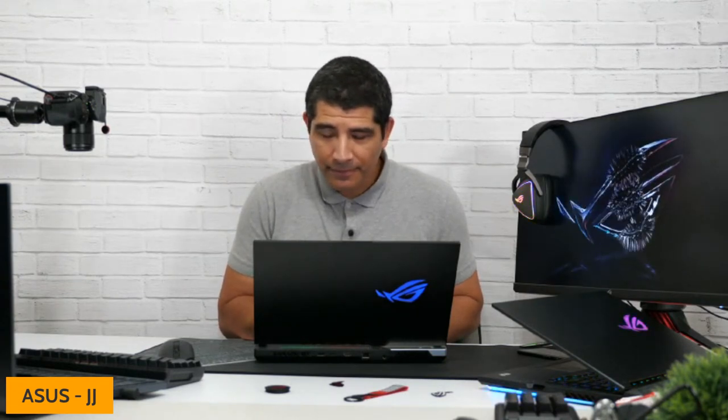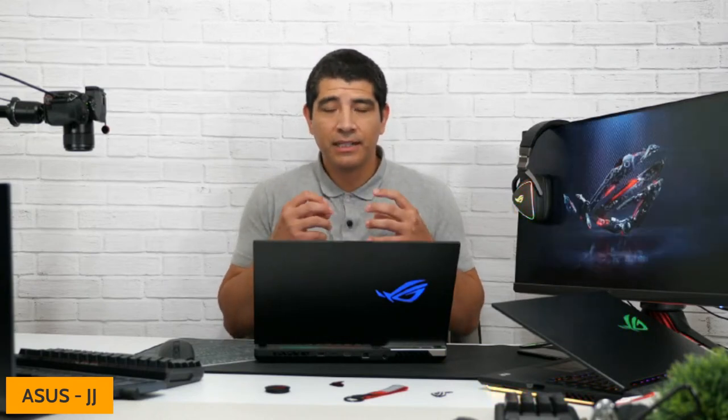Very nice. So you have that nice, satisfying, affirmed click experience, right? The tactility there, really, really nice. It continues to use something that we call our overstroke technology as well, which is actually a slightly higher level in terms of the actuation. So instead of it being about halfway in the depression, it's actually a little bit quicker. So you get more consistent and actual feedback. And of course, with it being optical, there are no debounce delay considerations, and so many other things that you have there.